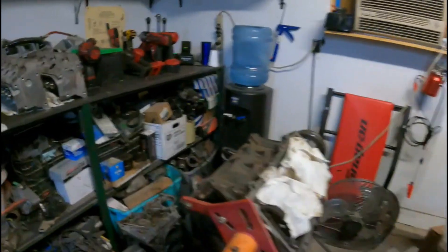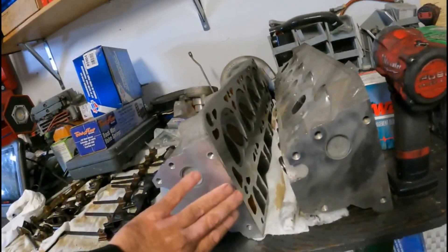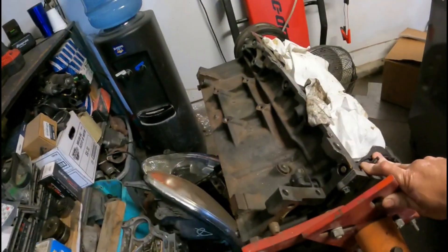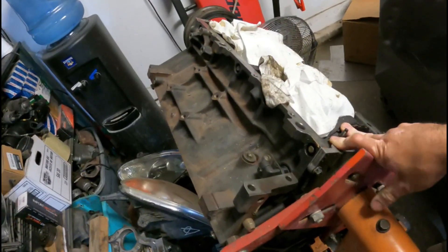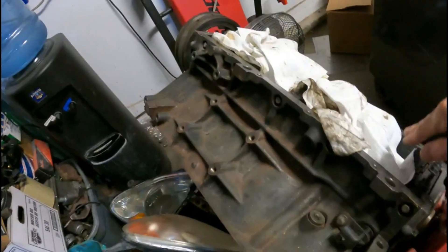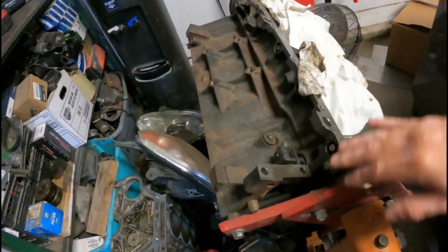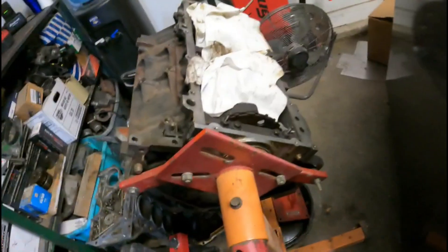Let me show you guys the heads. We already had them installed, took them to the machine shop, had them install the dual valve springs, and they went ahead and cleaned up the heads and milled the mating surfaces. These bad boys are ready to go. The block is sitting right here, and we are about to check the ring gap — make sure everything is good — because he will be going boost. We're going to be checking the ring gap on all the pistons, number one ring and number two. Resealing the whole thing: rear crank seal kit, front crank seal kit, we're going to paint the block, and it will be getting a head gasket set. Checking that ring gap will probably be the next video, so stick around.